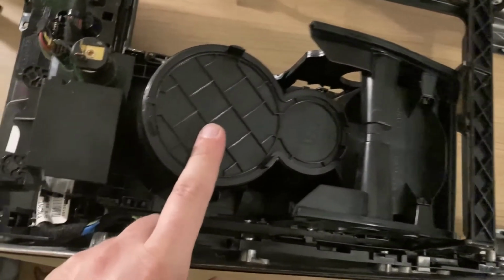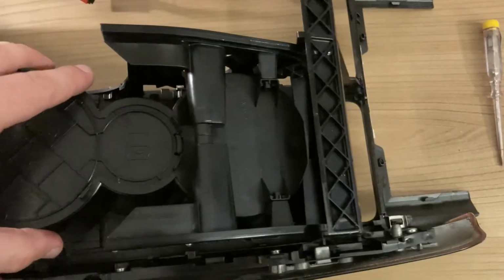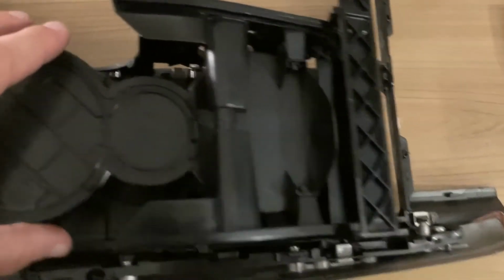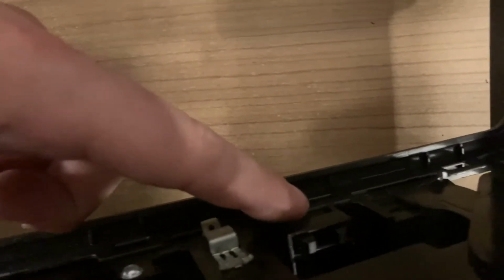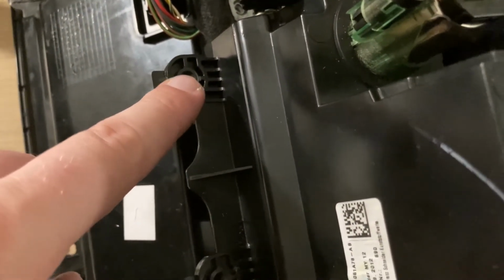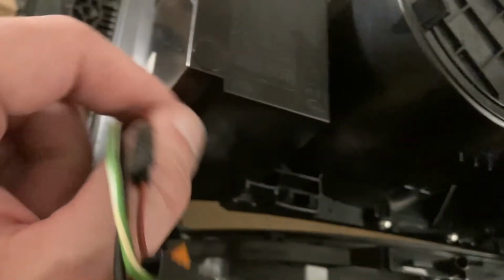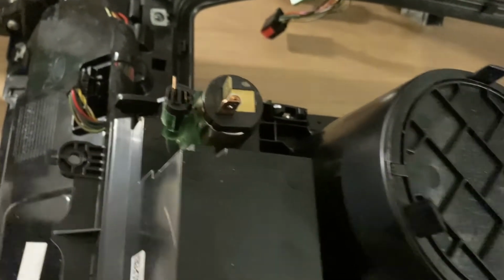Next comes the block with the cup holders, ashtray and 12-volt power socket. This one just slides in gently. On this side there are these 3 metal pins here that align with these 3 holes and they sort of click. Then you have to screw in 3 places, here, here and here. And at the end, don't forget to plug in the power connectors to the 12-volt socket.